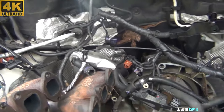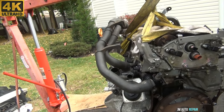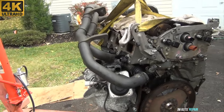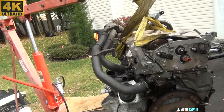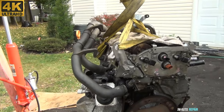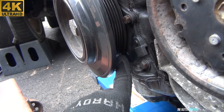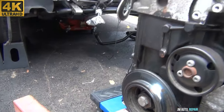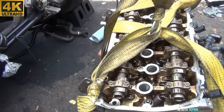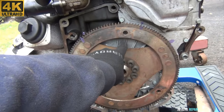Back with this engine — I have to take out the cylinder head, do the head gasket, do the timing chain, and check cylinder number one because I believe the piston is bad. I did a leakdown test and it had no compression. I'll be replacing all the pistons with parts from Audi. The timing mark on the engine block and the crankshaft pulley are lining up, but on the camshafts the two cutouts are not lining up at all — the engine is completely off time. It had a correlation code and a timing overrun code, so there is a lot to do.